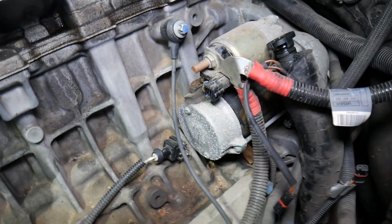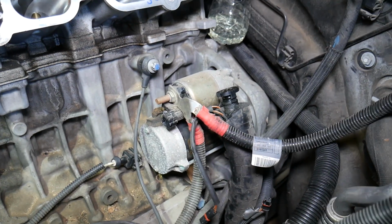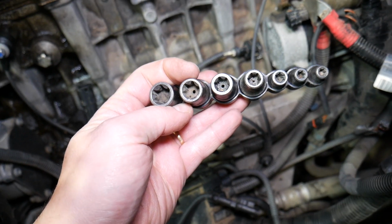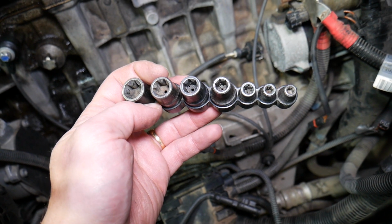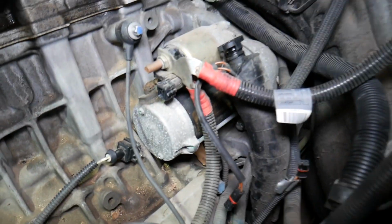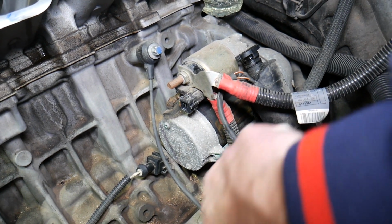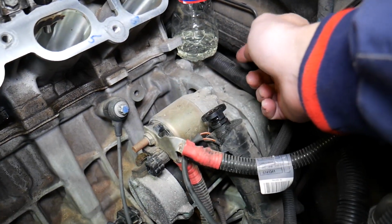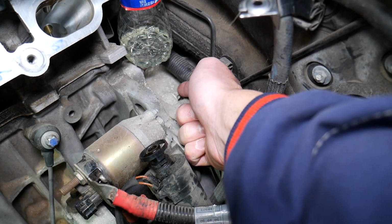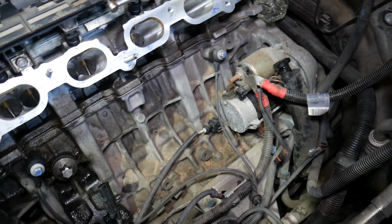Now you will need to get a 13mm socket, I think it was. Disconnect that wire here as well, the positive wire. And then we're going to need some special sockets. Those are the sockets that we use. Those are called female Torx sockets. We'll have the link in the description of the video below, please check it out. Once you get that socket, you have two bolts that you need to remove. One bolt is located right here, it goes this way, and then you have another bolt going that way from the transmission housing. The bolt I'm talking about is this bolt right here. So remove these two bolts and the engine starter will come out on the BMW X5.